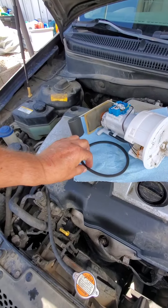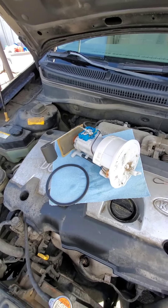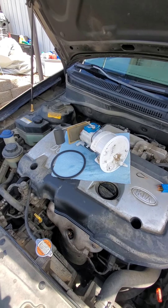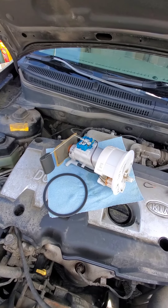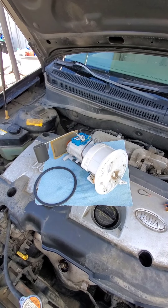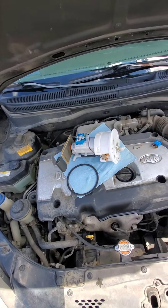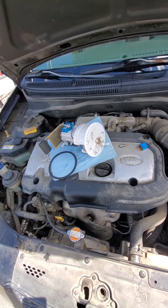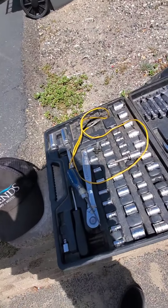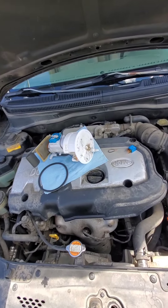It's going to be pretty easy to reinstall. There's a rubber gasket that slips up from the end and seals off the top, then it sets back down in the gas tank and you hook everything back up. I'm going to put it back in the gas tank for safety — I don't want 16 to 20 gallons of open gas sitting there to catch fire. I'm going to try a different, heavier jump wire real quick, just in case the test light wire isn't sending enough electricity to kick in the fuel pump.